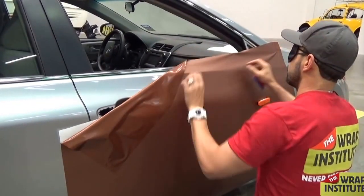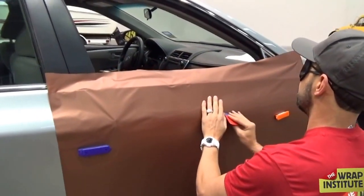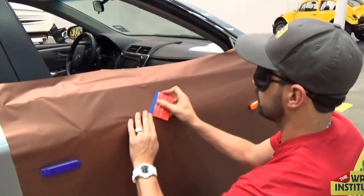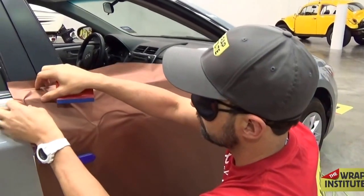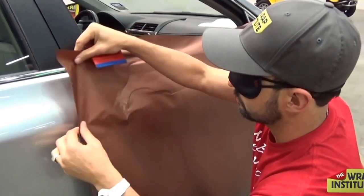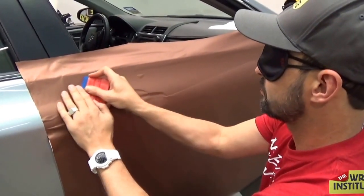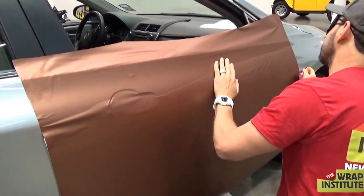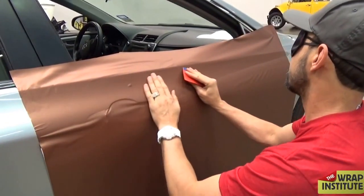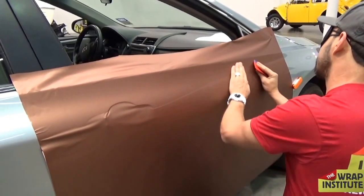Then I set a permanent hinge, pulling up with glass, nice and even. Once I get set up there, I want to lock it in place with one squeegee stroke. I'm feeling where the backing paper is, squeegee towards the right, feel through, make sure I have glass — almost. I felt it bunch up right there because of the magnet and the raised object in the door handle. So I pick it up, create glass, feel it, run it down with my finger, and lock it in place with my squeegee. I felt the bubble come up, but because I have air egress film, it went away.